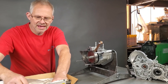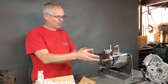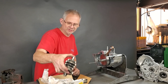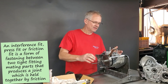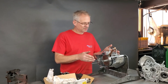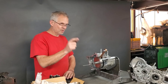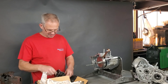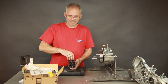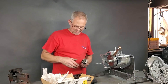Something I wanted to mention is that there's a lot of people that go back and forth in the industry about how a crank should fit the bearings. Some say you should be able to just slide it in. But I can tell you from being in the industry as long as I have and working on OEM cranks when they were still OEM - they are always an interference fit. The cranks are always going to fit tightly into the bearings. It goes back and forth on your school of thought - if you believe the crank needs to float back and forth a little bit as the motor is running to keep it out of a bind, then obviously you'd want it loose. But the way Honda designed it, it is an interference fit on both sides, and that's the way I like to see them. Have I run motors that are loose on one side? Yeah, some of my best race motors do that. But honestly, the way Honda made it was an interference fit.